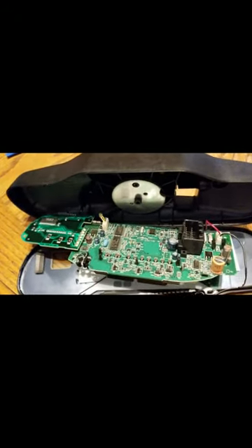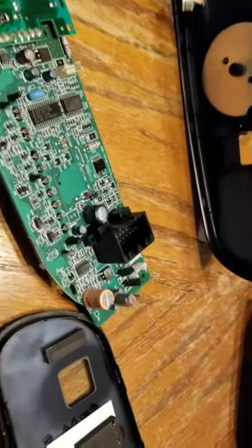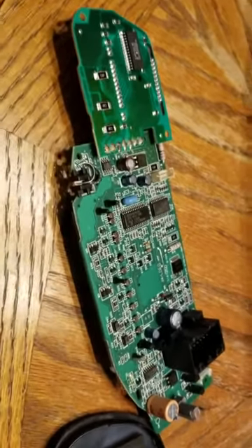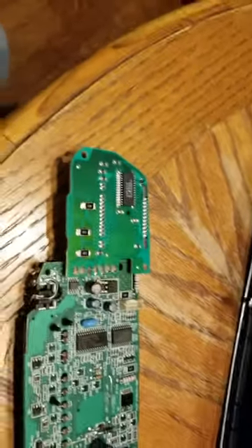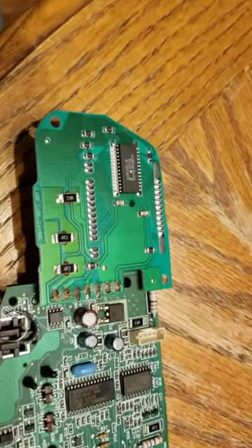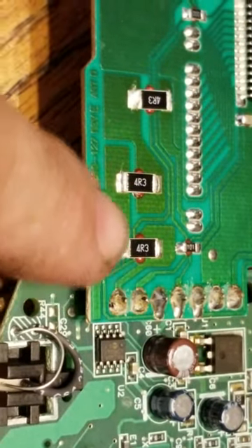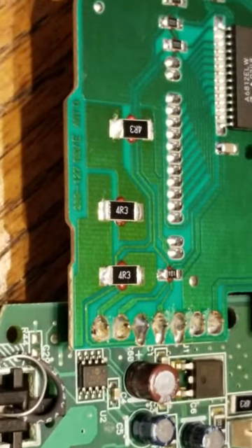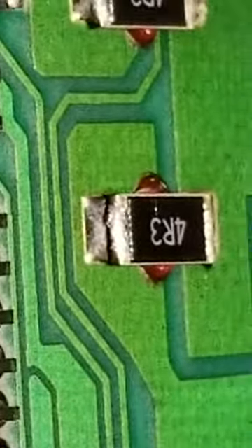I got the wiring off. When you pull this board out, you can see the wiring connections. Right here on the display you have these three resistors. The one I repaired — you can see it right here — the top of it is cracked, and that's why mine's not working anymore. You can see that crack on there — that black line is a crack of the solder joint right there.